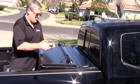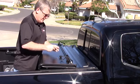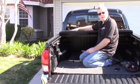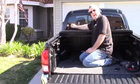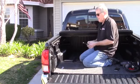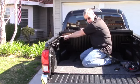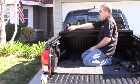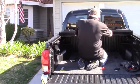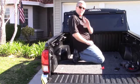Now we've got to place the elevator bolts through to secure the cover in the front. We've set the cover on the rails, with the short hinge panel and mounting holes at the front next to the cab, and the buckles already installed. Before installing the elevator bolts, make sure to add the cab bumpers to the cover — three fingers from the side for clearance from the rail, right along that top edge of the panel. If you have a slider window, place the bumper in the middle; on other trucks you may split it in two on each side to prevent direct contact.